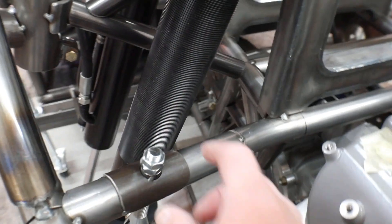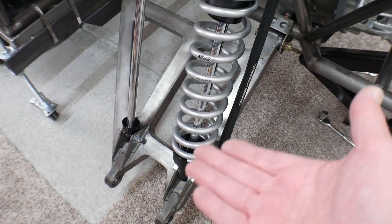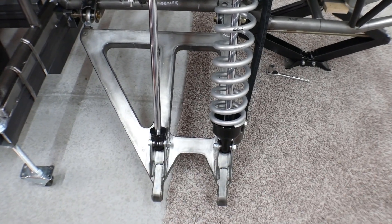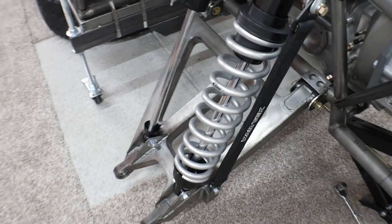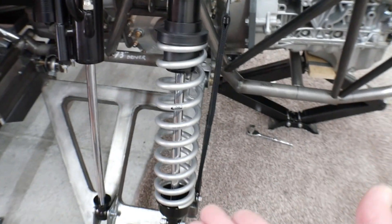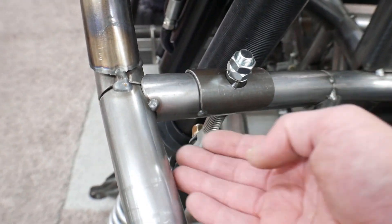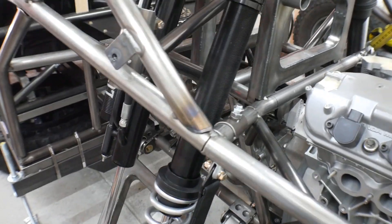Now I've got both sides installed — she is good to go, well, lightly tacked in place, but good to go as far as installing the limiting straps. I like this setup because it ties into the lower control arm basically as close as it can to where the coil carrier connects. If it was connected further over, then as it came down there would be a little bit of torque on the lower control arm — I really don't think that would be a problem, but again, the more you can stack physics in your favor the better. So this runs the connection point of the coil carrier and the limiting strap very close together, so there's not going to be a lot of torque twist, and it's pretty straight for the limiting strap. I was kind of in a hurry and coming up with quick ways to do this, excited to start tearing the chassis apart for final welding, and I just kind of caught myself.